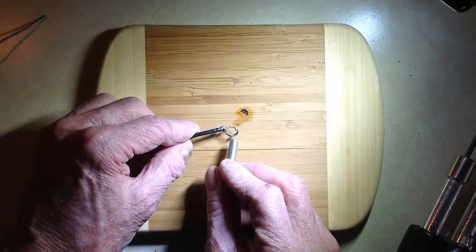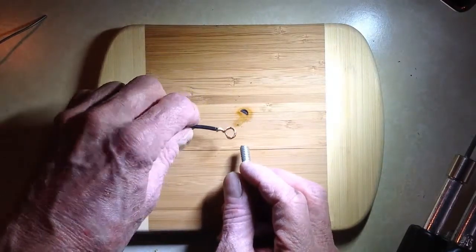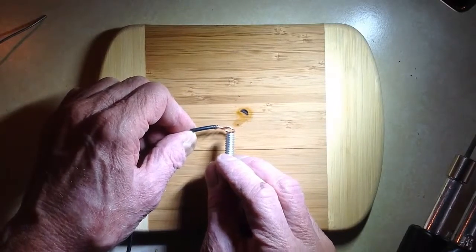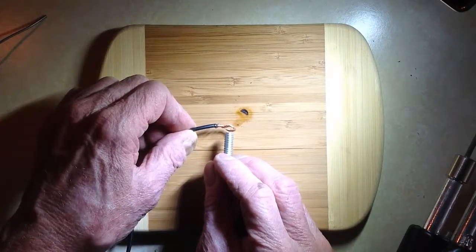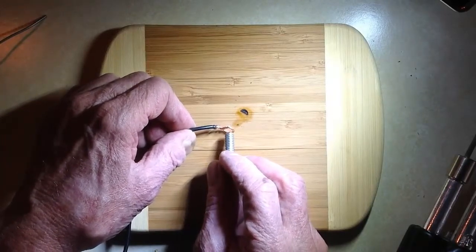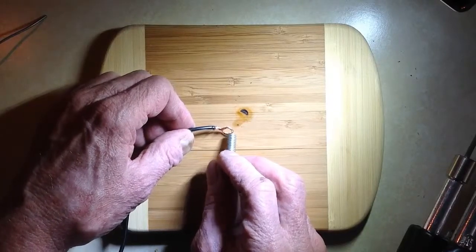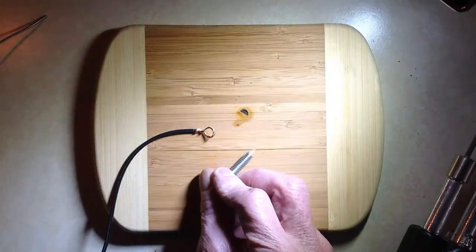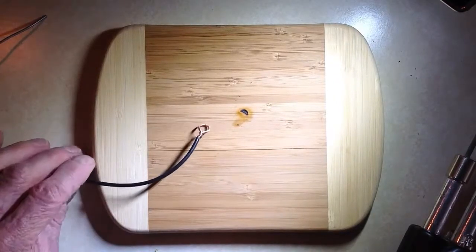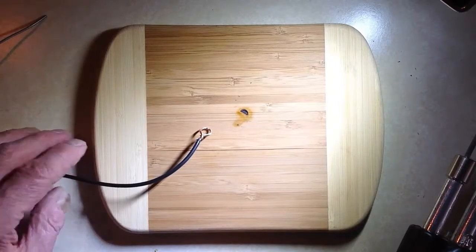There you have it. Now I do that to the other end of the wire — already pre-looped it — and then I'll screw one end into the antenna mobile mount base, which is grounded to the coax shield. The other end goes into one of the little holes that's been provided by Toyota with such forethought in the bed of big number eight. Until next time, Stan Gibilisco, W1GV, Whiskey One Golf Victor, saying 73 and so long.